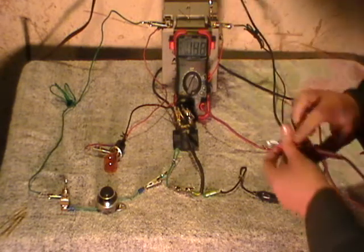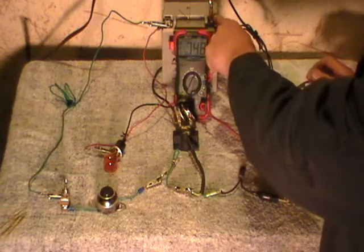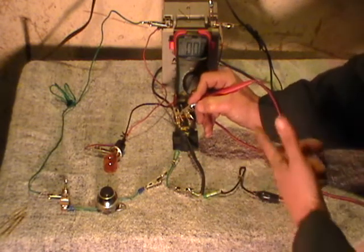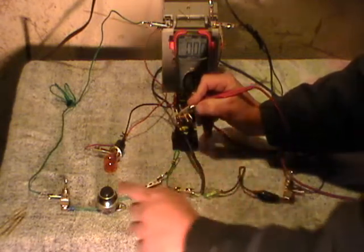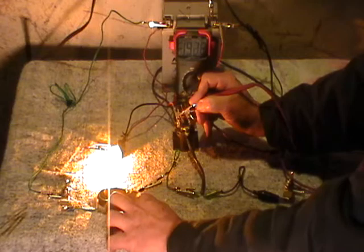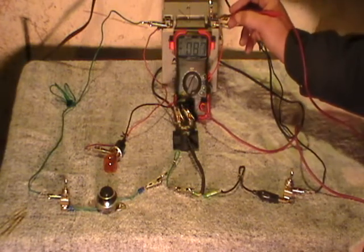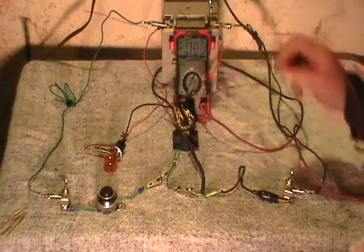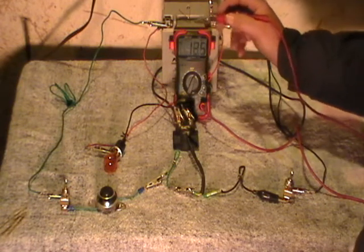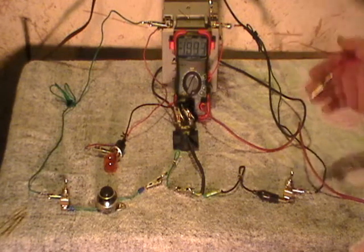I take one lead from my multimeter — still on DC volts — and go directly from the battery post to the power post of the solenoid. This post has the direct wire from the positive battery terminal to the solenoid. Right now we'll be at zero volts because no current is flowing. To operate this, I have to pull in the clutch, turn on the ignition switch, and push the starter button. Right now we're running about 190 millivolts — essentially nothing — which means we're getting good power with no interruption to the solenoid. But if we were climbing up to three, four, or five volts, we'd have a problem.